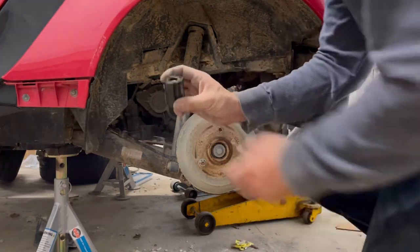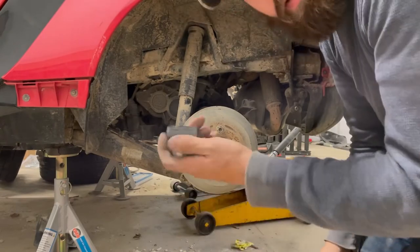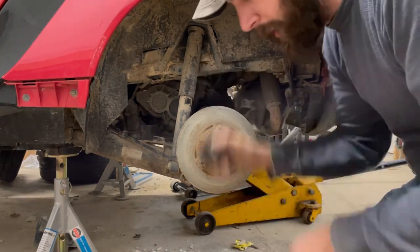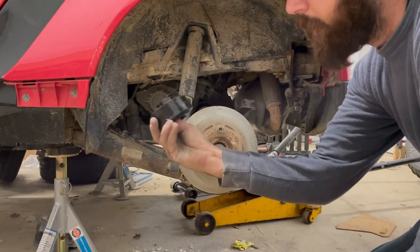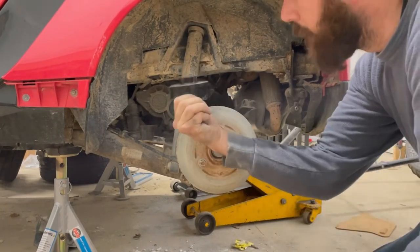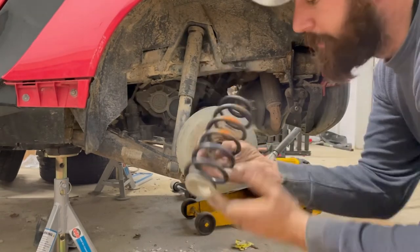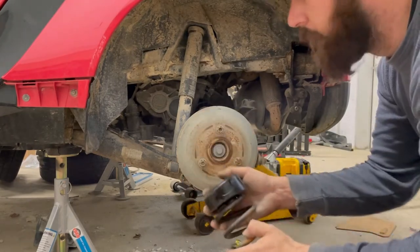I got the correct shim in now. Push that down - it's nice and flush with both sides, and once it's sandwiched in it'll be nice and tight. You're going to need a washer that goes underneath, but I'm going to put the spring in first along with the lift block because it is a pain. The lift block is actually angled - it says to angle it towards the front of the car, and it's actually printed on the top 'front'. I reuse one of the isolators at the bottom of the spring, place it in there at the bottom, and drop the block on top.